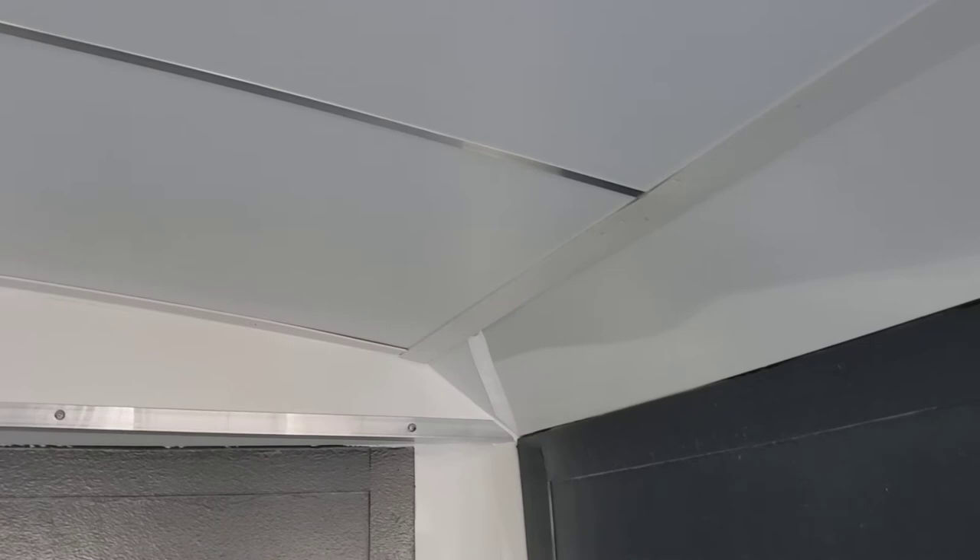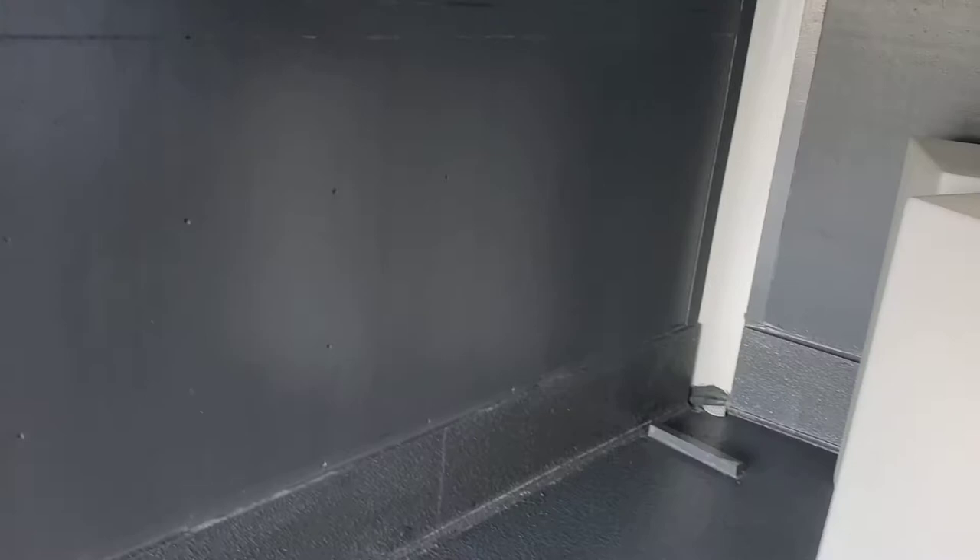You can see the nice vent up here. I was really impressed with the finished details — it's a really nice trailer on the inside, much nicer than the other product I had purchased. A couple of other upgrades: you can see the screws are a foot apart. We also put the floorboards 12 inches on center, and the wall braces 12 inches on center as well. This is a really cheap upgrade that makes the trailer a lot more durable. I'm looking for my trailers to last a good 10 to 15 years before I sell them, so I really wanted to make this one as durable as possible and protect it from the elements and the cleaning products I use.